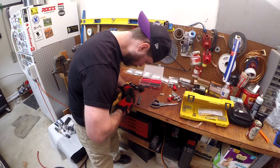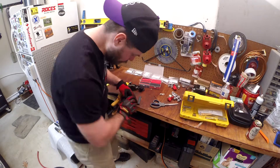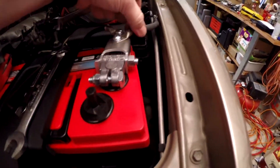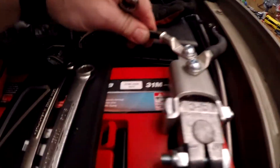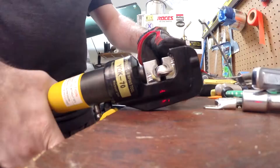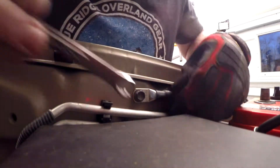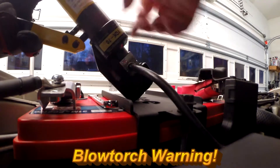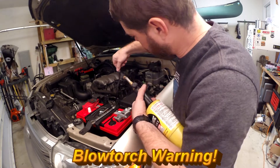This was right about the time I realized I did not have the right eyelets to do the single-aught wire, so I decided to switch gears and rewire the primary battery ground cables. I upgraded the ground wire from the terminal to the chassis with two-gauge wire, and crimped on a new eyelet to the main wire from the block. If you haven't seen my other warnings — blowtorches for shrink wrap, probably not the best idea.